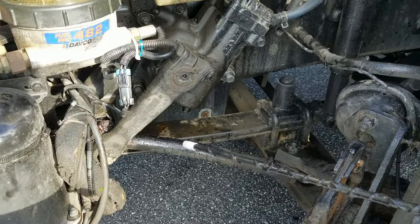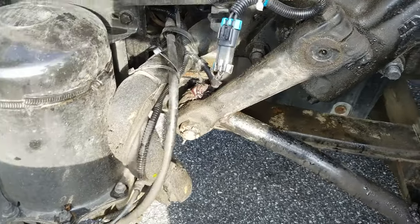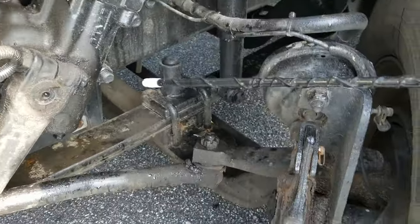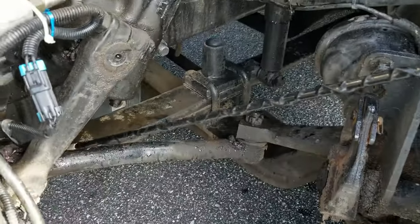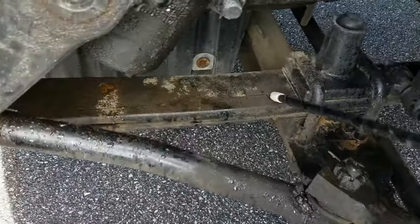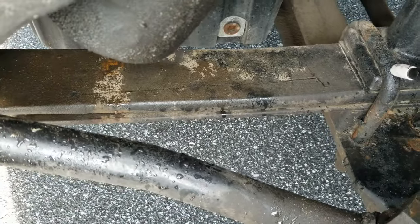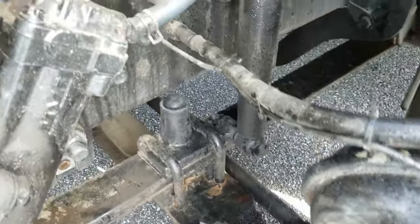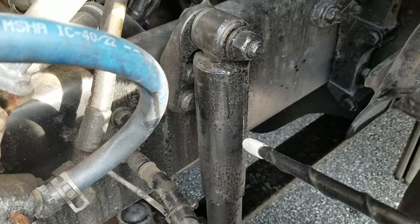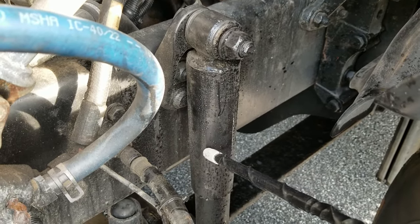I'll move to my suspension. I'll check my spring mounts, front and rear, to make sure that they're securely mounted to the frame, no loose or missing bolts, and no damage. I'll check my springs to make sure that they're not shifted, cracked, broken or missing, and held on with two tight U-bolts. I'll check my shock absorber to make sure that it is securely mounted, no loose or missing bolts, and it's not cracked, dented or leaking.